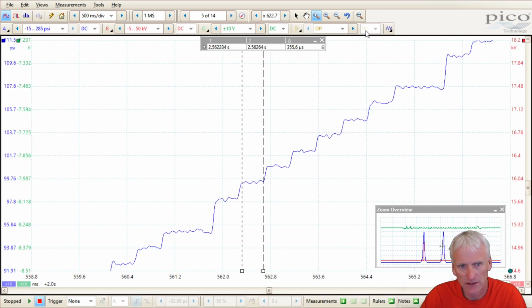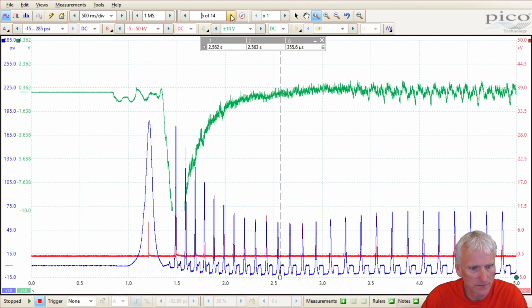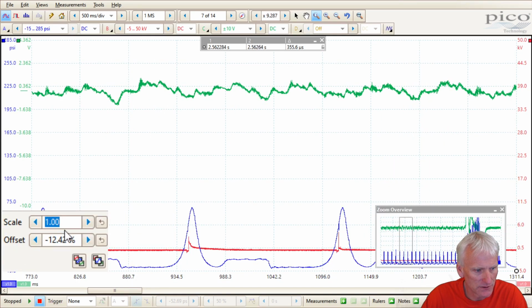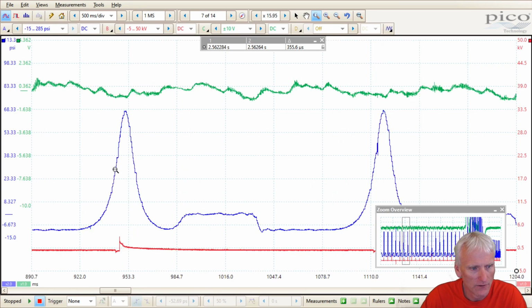So it's much faster than the eBay sensor, but at least twice as slow as the Fluke PV350, maybe even a little bit slower than that. But if you take a look, we'll go to the running compression. There's a snap throttle. Pick a few before that, and I'll zoom in 2 times. Make that pattern a little bit bigger. It's actually not a bad looking pattern. It is pretty smooth in my eyes. I think it's acceptable. There's some blockiness, a little bit of stair stepping, but nothing like the eBay sensor.